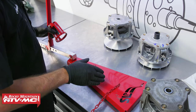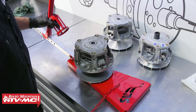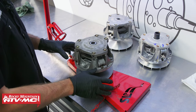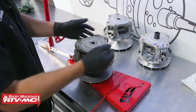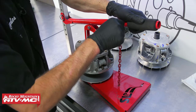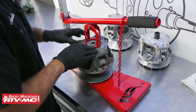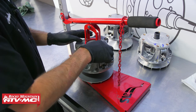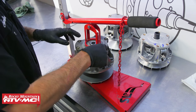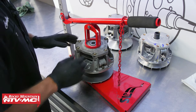Set the drive clutch on the press tool. For this drive clutch, the spring doesn't have a ton of pressure on it, so you don't have to have this tool. For the driven clutch you really need one, but if you have it, it just makes the job easier and a little bit safer. Compress the spring a little bit, then remove the bolts the rest of the way. If you're not using this tool, back the bolts off evenly in a crisscross pattern as best as you can.